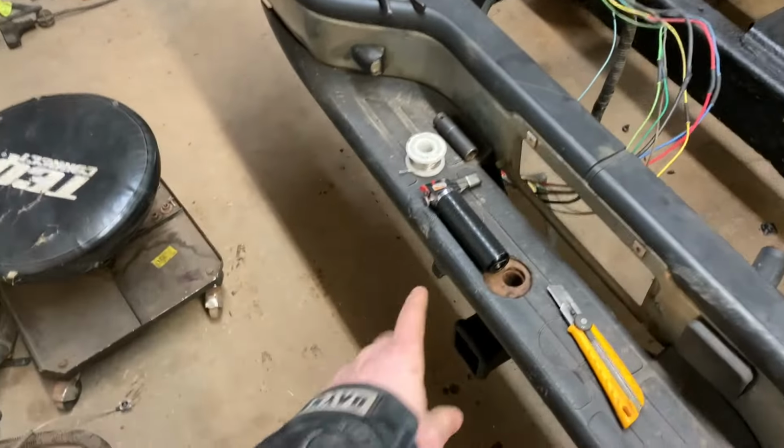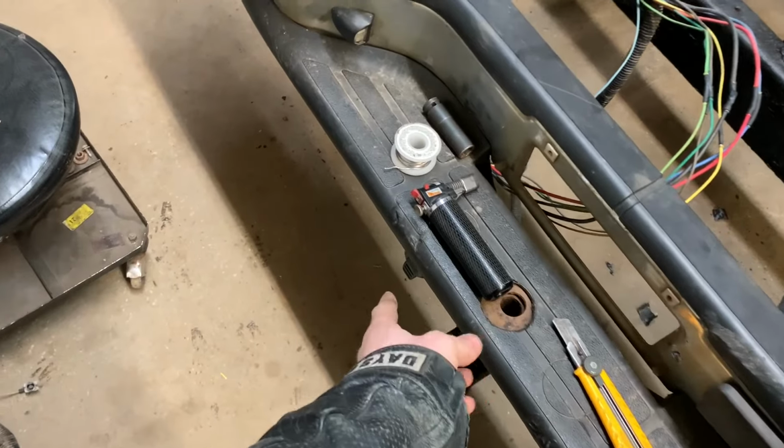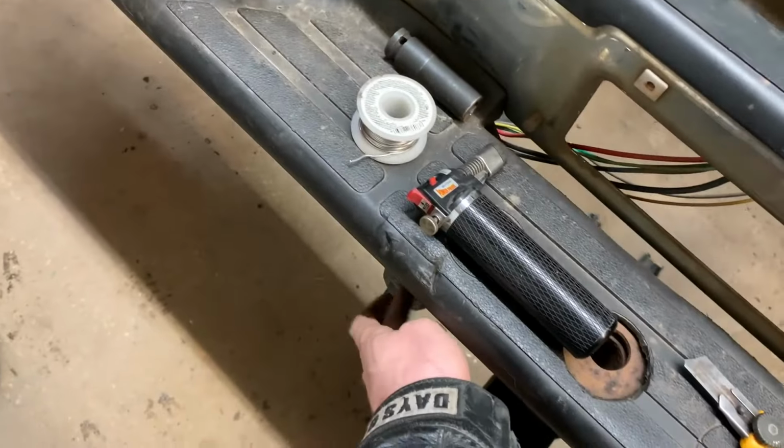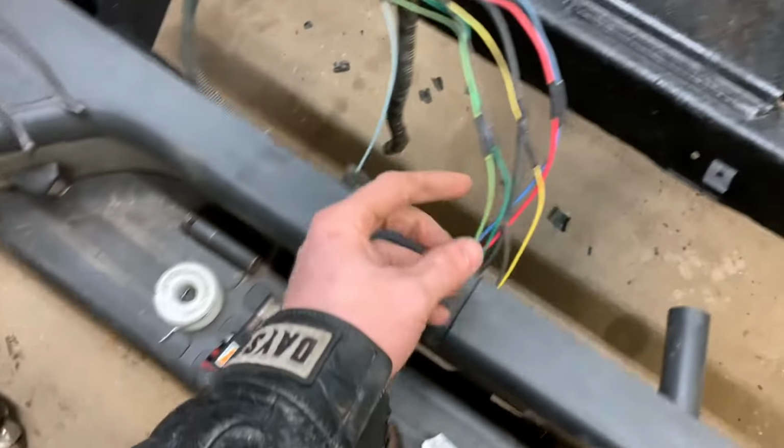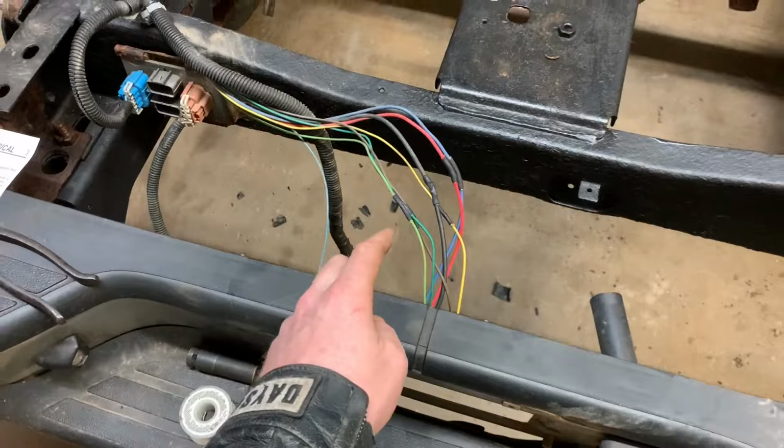I also went ahead and plugged the harness into the back of the trailer connector here, and I ohmed it from that one corroded terminal to the ground wire right here before I joined them, and I had 1.5 ohms over about 2 feet of wire, and it was still a little bit corroded before I actually scraped the terminal off, so that's just fine. The connection is just fine, and I'm also going to put dielectric grease inside that cover, like I said.